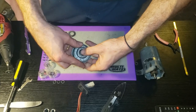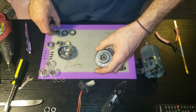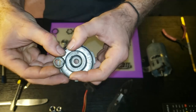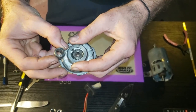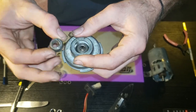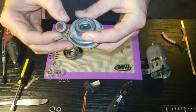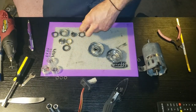Back to the task at hand - since my brushes and stator are all good, the issue I had was the front bushing on this got so wallered out. You can kind of see there that it was making a hell of a racket, did a little bit of damage to the brushes - not enough to worry about - but I needed to replace this bushing which was in the front case, which is even harder to get to.